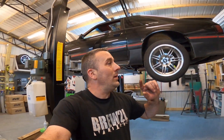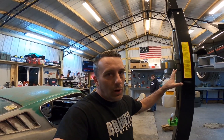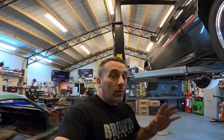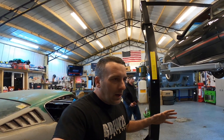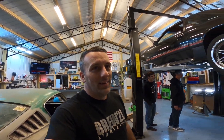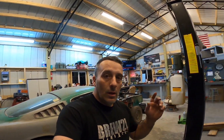As you all know, we went to the track and results were decent at best, but overall I'm happy with the car — it looks promising, the engine is making good power. We're about to have to buy a new clutch, new input shaft, and all that type of stuff. The reason I'm saying input shaft as well is because we still have a 10 spline, and if we're going to upgrade we need to go ahead and upgrade to a 26 spline. That's a lot of money.